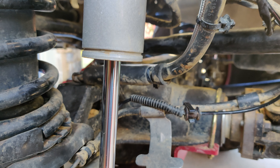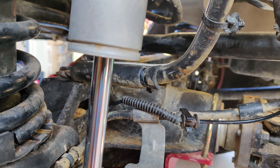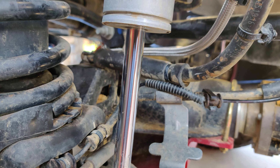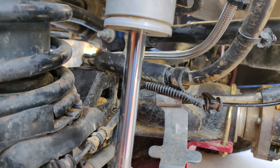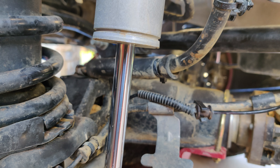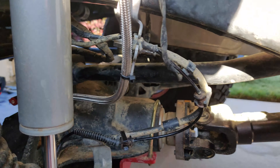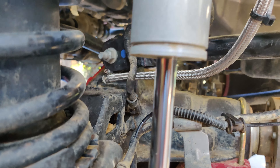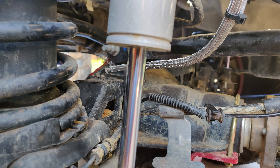I'm going to do the rear the same way — matching OEM with regards to the angle, the curves, and the amount of play. If you put too much play in it, it will sag and when fluid comes out through the breather line it will pool at the bottom and block air. You always want it at a slope so any fluid that gets in will drain back. I couldn't leave too much excess by the axle or it would create a droop.